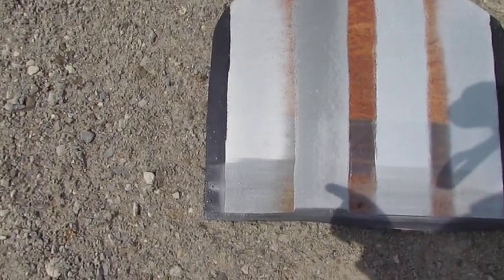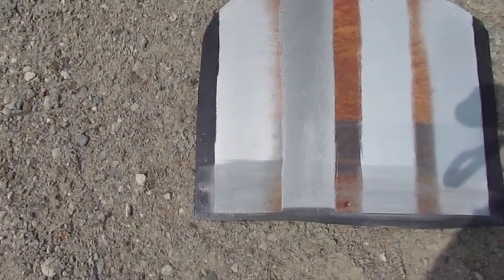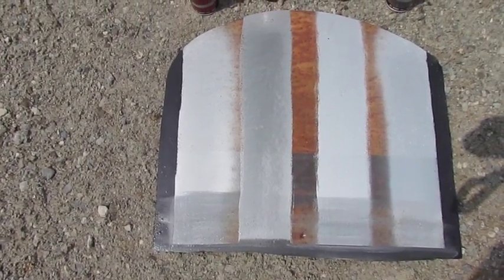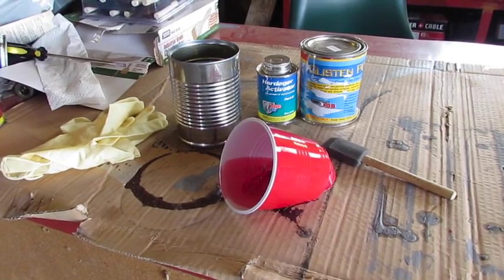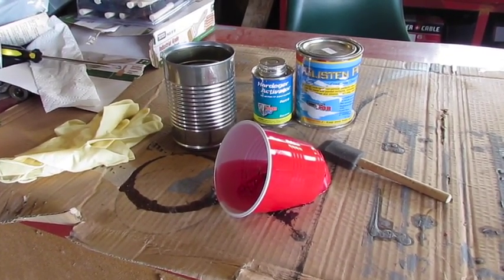The silver primer had no issue. The other paints needed probably an additional 2 to 3 days to dry before I'd applied it. There was some streaking within the paint. Part of the reason for doing a test paint is to confirm product compatibility.